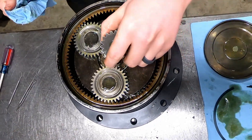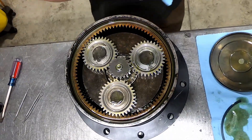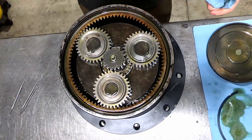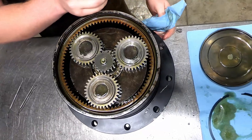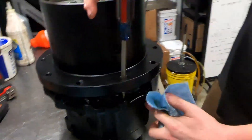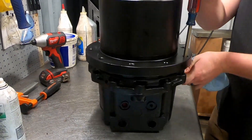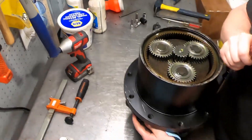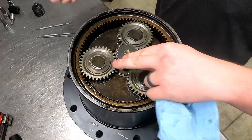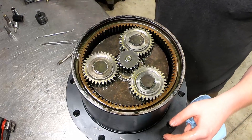After that, this will go right down into that brake sun shaft gear, and most of the time it's going to be misaligned. What you can do is get a screwdriver — really anything — and it will spin freely until that shaft's lined up. You can see here, just between the two housings. I'll push and you can watch this thing fall into place. Just push until the teeth get right where they need to be, and sometimes it takes a little tap because the gears are a little tight.